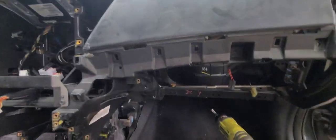The last thing to mention is there is an airbag down here that you'll have to disconnect. It's bolted down right here - you pull this tab back and the airbag just slides out. Don't yank the dash out too hard because there are two speakers to deal with. Pull the dash out a little bit, disconnect the speakers, then pull it all the way out - that should be the last thing.